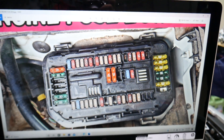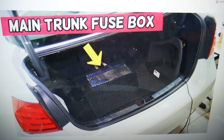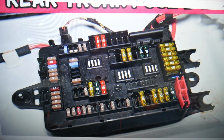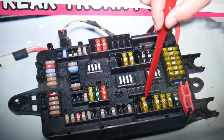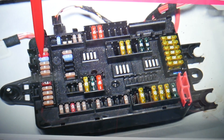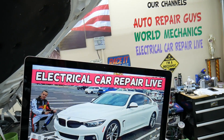After that, we're going to go to a different fuse box that's in the trunk — the main trunk fuse box, under the cargo liner where that arrow is. Just pull the cargo liner around and you'll see the main trunk fuse box. Here we'll need to check fuse number 137, then 144, 145, and 146. Hopefully the video will be helpful. If you have any questions, let us know. Thank you for watching and see you next time.